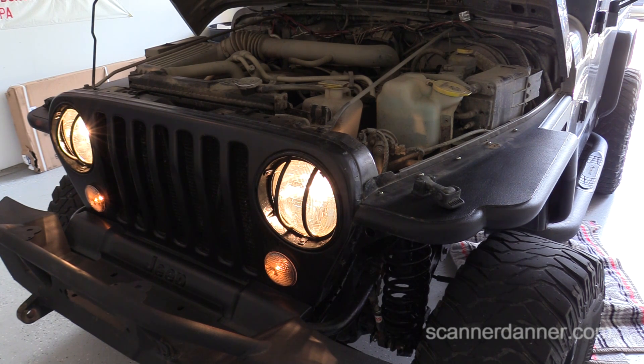We saw no change whatsoever — the lights are pretty bright. It's an older-style light so they're a little more yellow than today's, but what that tells us is this is not a battery problem, and doing a jumpstart is not going to help you. That's the first check. The lights staying bright says no current flow is getting to the starter motor, and a jumpstart is not going to help.